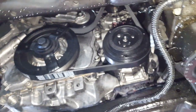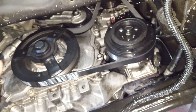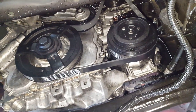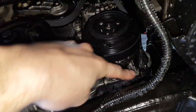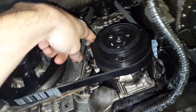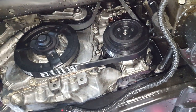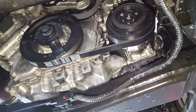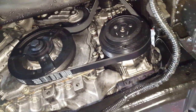The proper solution is to remove the engine, split it, and reseal it. There may be an alternative: if you remove the compressor and unbolt it, then clean this area really well with degreaser — get it clean and dry — you can maybe try an epoxy urethane solution on there. That might work.